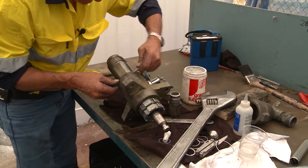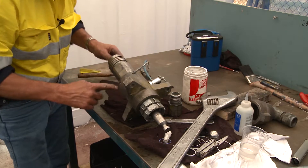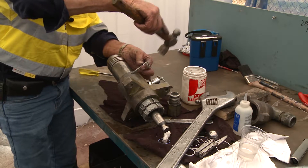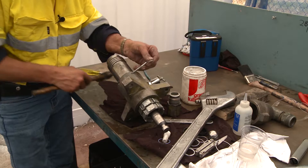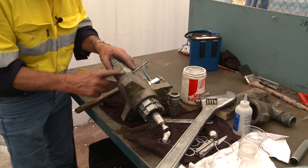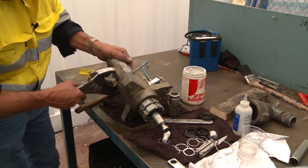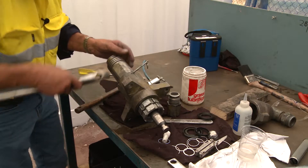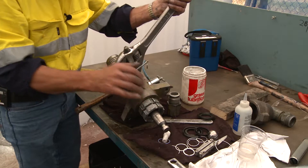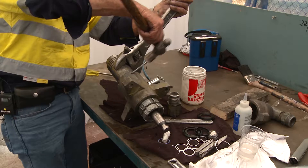There is a tiny little ball bearing in there with a spring under it, so we want that to depress and go into the flat section of the cylinder wall. If I tap this and feel resistance, just back it off a fraction and make sure you pick up the flat section. Take your time — don't rush it, because you'll end up bending the pin. Turn it back until you think it's about straight and try again.